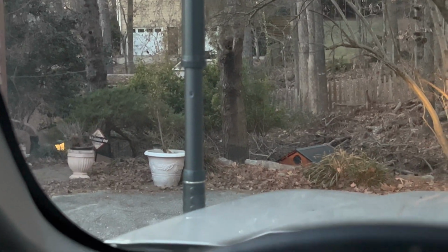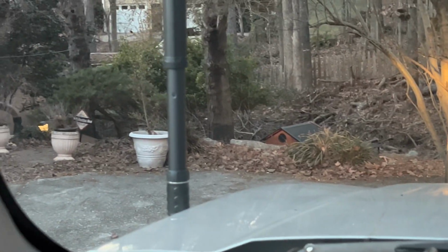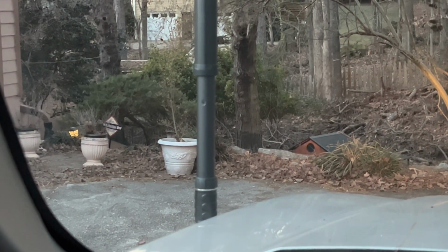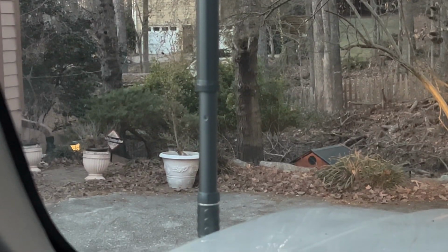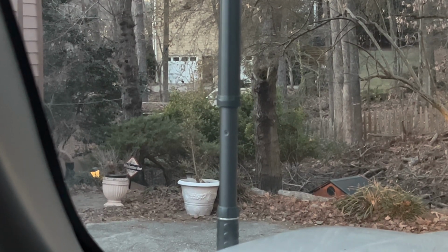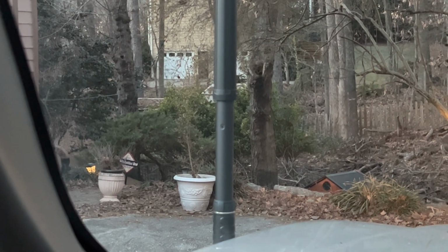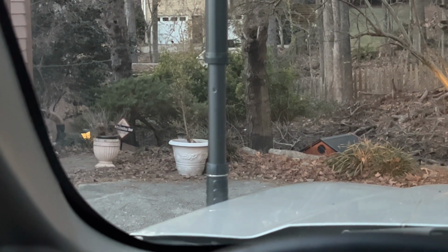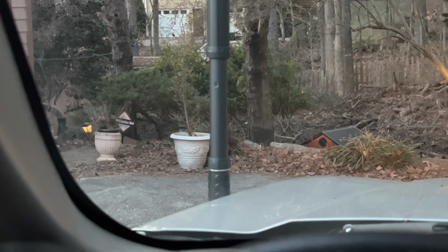Yeah, the ATAS-120A might have a lobe in the direction of Canada, which is helping it out here. Because, you know, it's not an ideal place to mount an antenna. And the ham stick is dead center top of the vehicle, and of course it's 7 feet tall. So that was pretty good. I'm impressed with that performance. Not bad for a shortened antenna mounted down on the left side of the hood there.